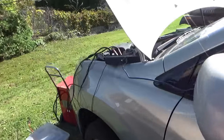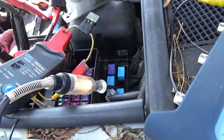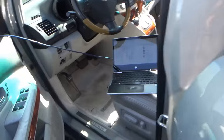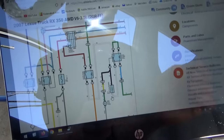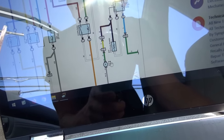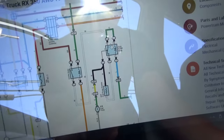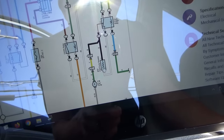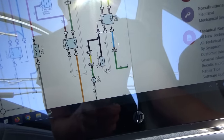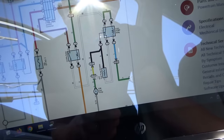Okay, that's unplugged. Test light is still lit brightly. How about that? Fantastic. Okay. So, suspicions are correct. So, fuel pump's unplugged. Let's get the test light from battery positive now to this green wire coming, you know, I want to check it going this way. So if we pull the relay out, we unplug the resistor, unplug the pump, then we're basically narrowed down to this little tree here. If there's a short to ground, that's what we're focused on.